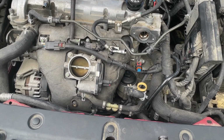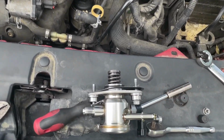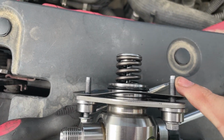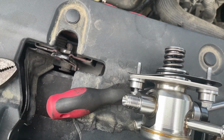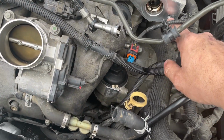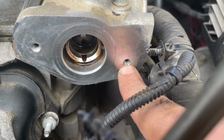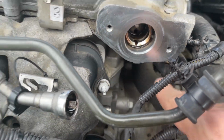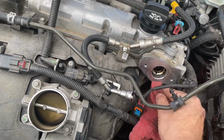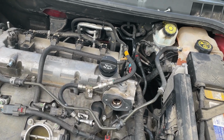The other thing I want to show you is the bolts are different even. These are the bolts that came in that other box. These are the bolts that you get from Standard. These are OEM bolts because it's got the leader on the front of the bolt before the threads so that you're not jamming these right into the threads and screwing your threads up. See, because if you use just normal thread bolts, look what you do. You end up damaging your threads in your engine. So I'm going to have to clean that out with some brake clean. Get all that garbage out of there so that when I tighten this down, it'll work.